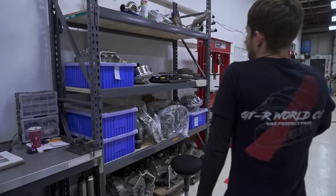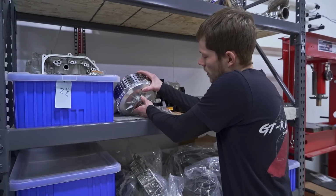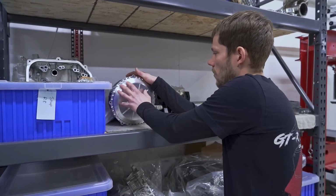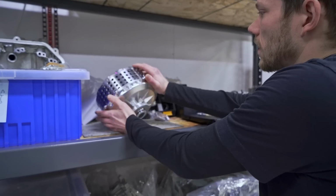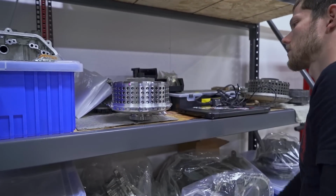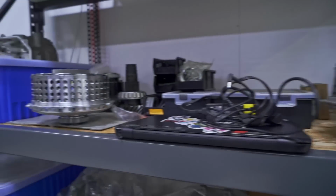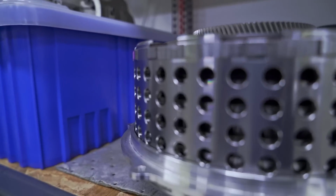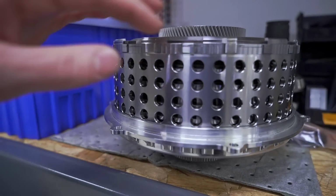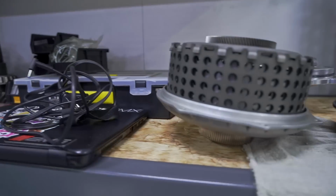Yeah, there'll be upgraded clutch packs and frictions in there, frictions and seals, and then this is all billet from Dodson, and these baskets are much beefier than the stock ones. That's a stock one right here, right? Yeah, you could immediately tell. There's a snap ring up here too. In comparison, that one doesn't have a snap ring in it right now, but it's definitely much beefier.